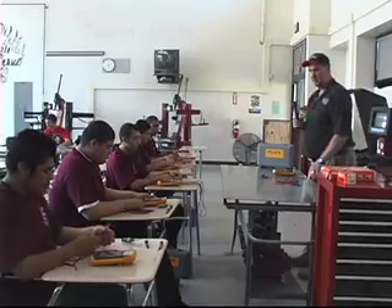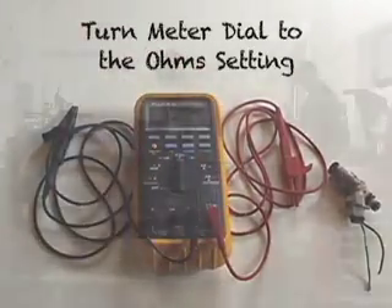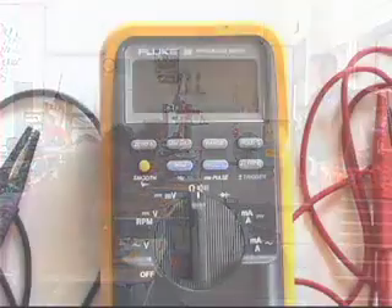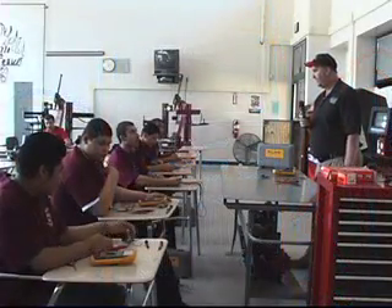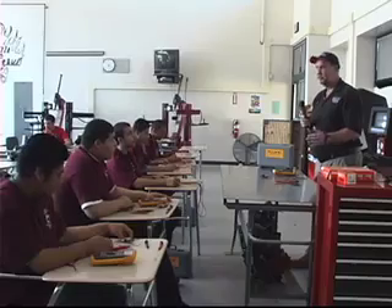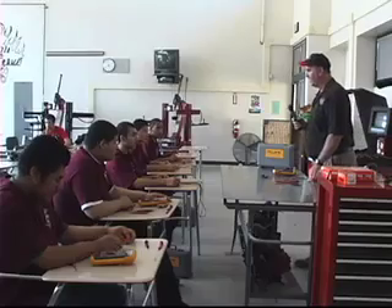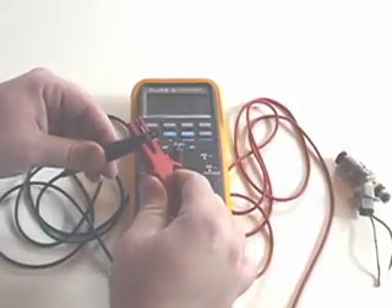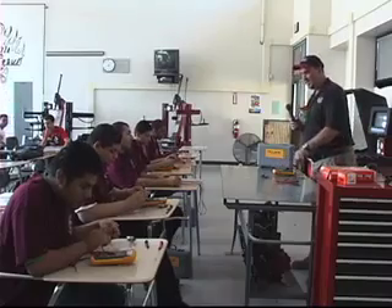You've got your injector in front of you. Go ahead and turn the dial to where it points to ohms. What is the meter saying? O-L — that stands for out of limits. If it's not hooked up to anything with resistance, it's an open circuit, meaning there's infinite resistance between the two leads. Now go ahead and touch your alligator clips together — the metallic part — and see what the meter reads. It goes to zero, which means there's no resistance in that complete circuit.